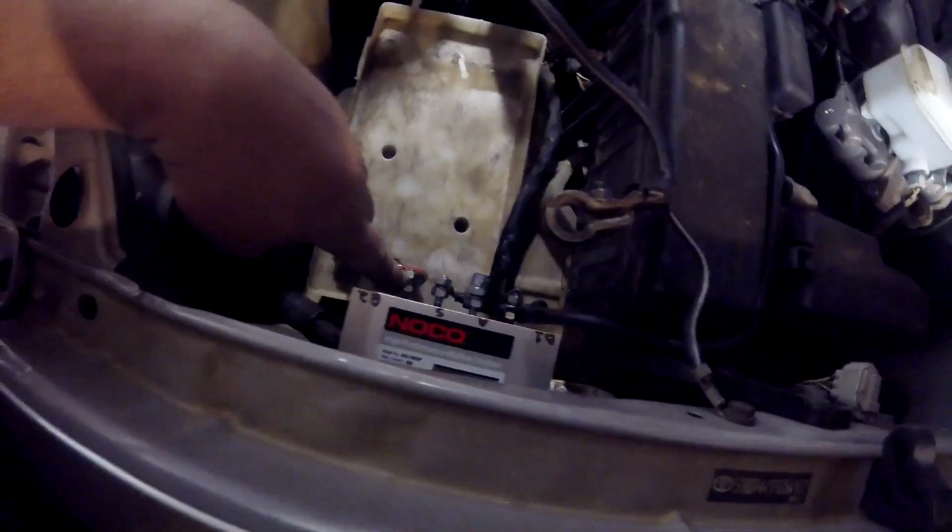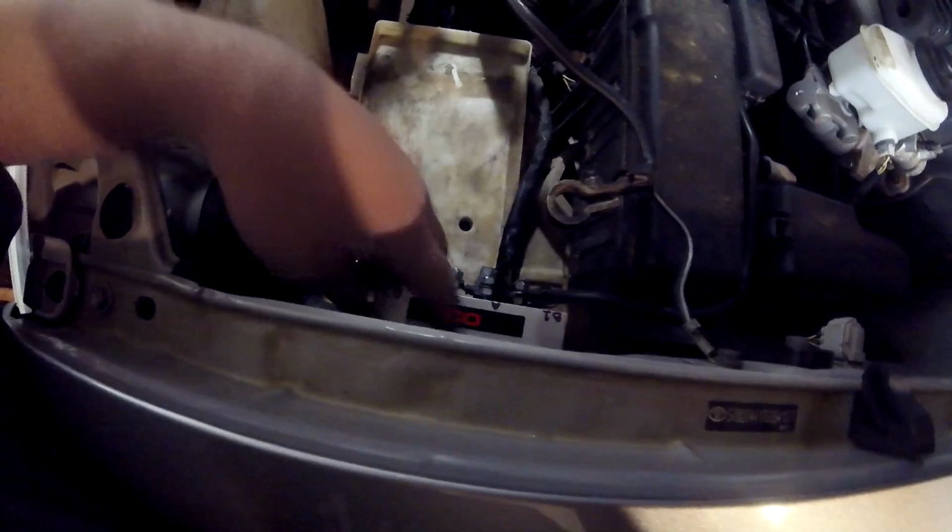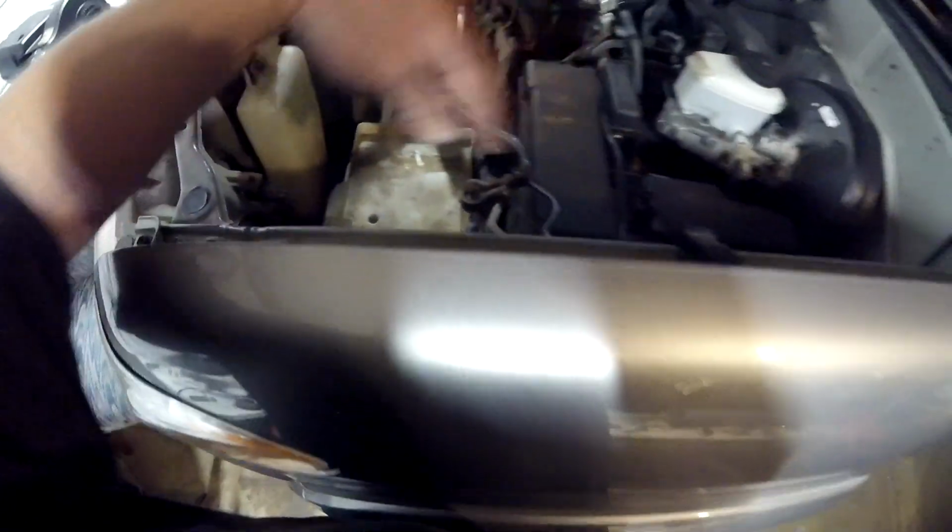A lot of guys called me and talked about this before, doing this at the track, different people. And they said, well, Q, you only need one fuse back by the house batteries. No. That isolator is putting out over 14 volts. That isolator is connected through diodes to the alternator output. You cannot short that out or you'll damage your truck so bad it'll leave you stranded somewhere.